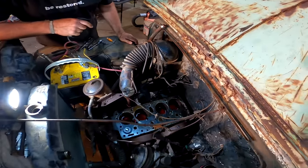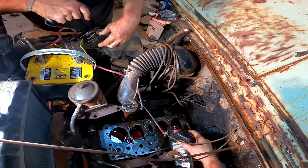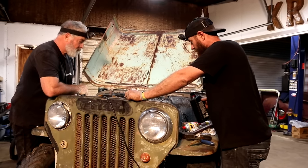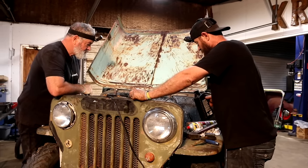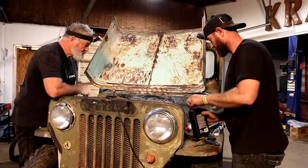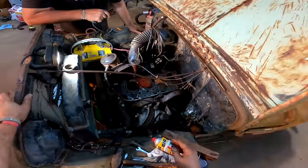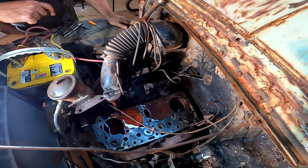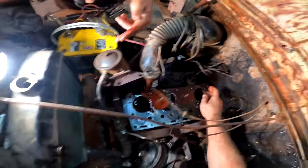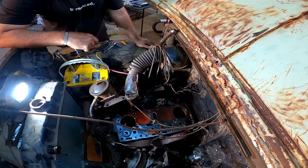Speeding up a little bit, isn't it? I see it's not completely got all on this piston here. Some of the dry spots there. I'm hoping that transmission fluid will help clean up those rings a little bit. Looks like all the valves are opening and closing like they should on this part, so that's good. I think it'll turn over a lot better too once we get that diesel out of the block, get some oil down in there. Something that's made to move, slick it.